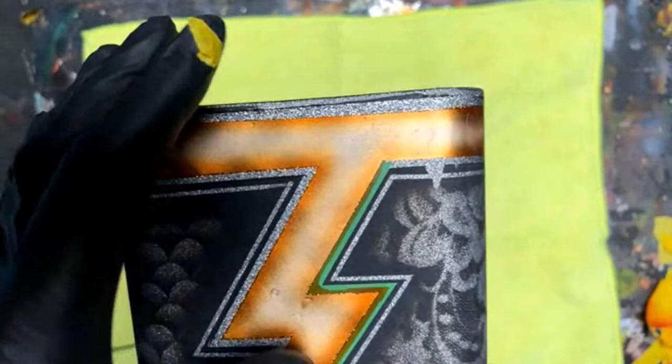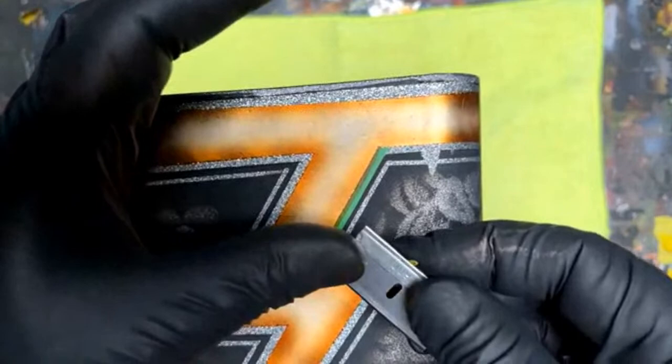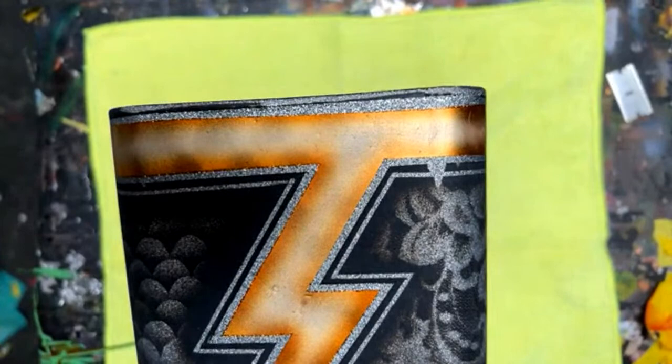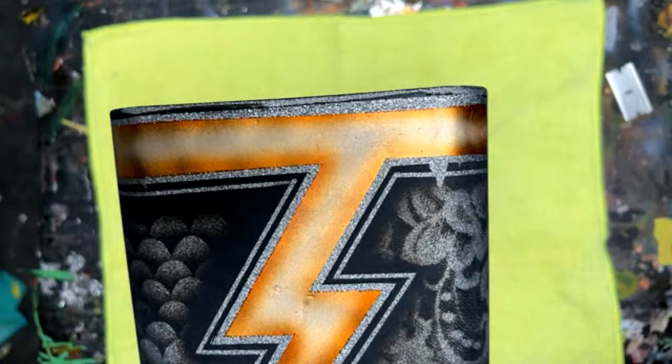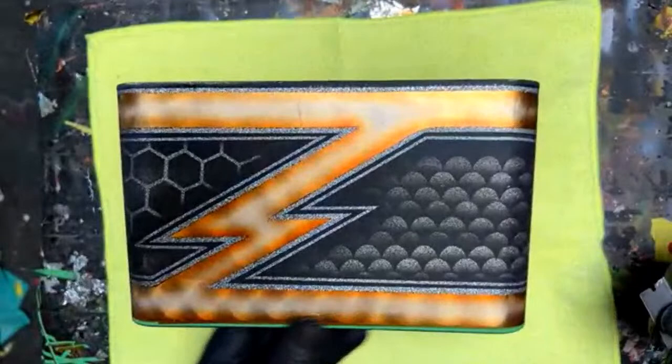Like you see me spray glass cleaner on stuff all the time, right? Here, spraying glass cleaner on this to clean up the residue, and maybe even before I take it into the booth. But if you were to do that using waterborne paints, it would literally take all that paint right up. So just know your paints, what you're working with. Not all the rules apply to water-based as they do solvent-based. It's going to be a different animal. But they both work. If you were asking me, I would say solvent-based is going to be more friendly, especially when you're new, because there's a lot of issues that can come up. As we know, me being a 20-year painter, I'm still fixing problems.